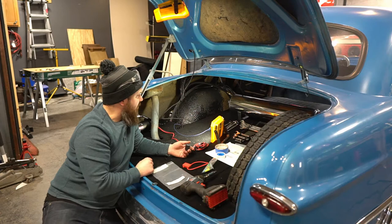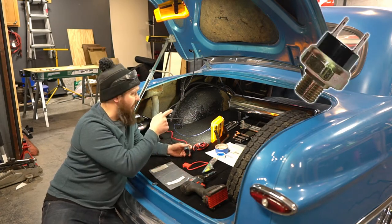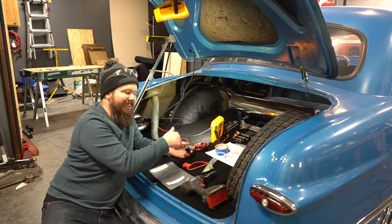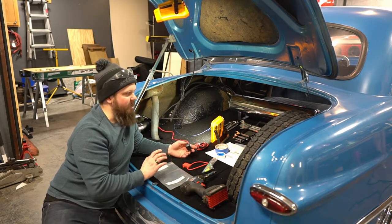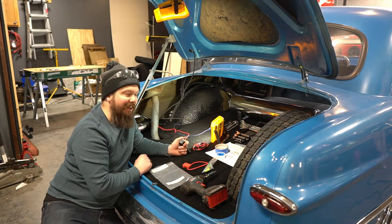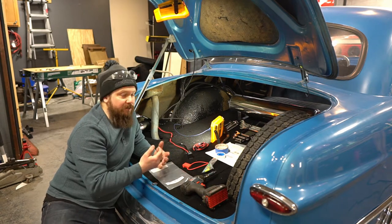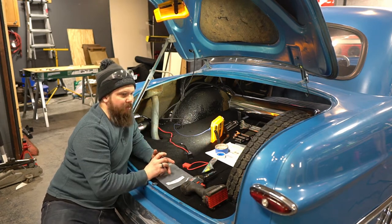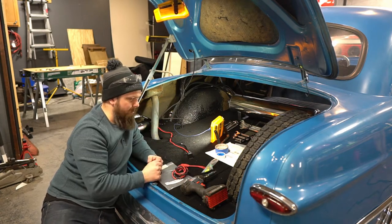And what's awesome about this is that we're able to use the pressure switch on the air tank to deliver an ignition switch 12 volts. I know, we're in the weeds here, but this is how it works. It's very simple once you get looking at it. I might be throwing a little too much info at you, but yeah, very simple. We're going to get that connected right now. We're also going to worry about running these leads back to the battery right away. Obviously, we've got to fuse it. So with this one, all right, let's get started.